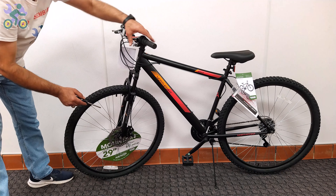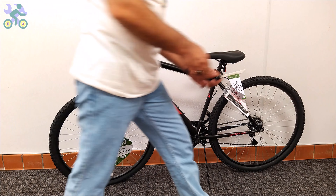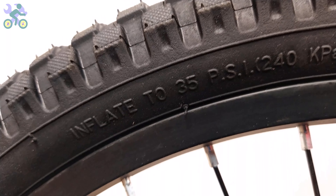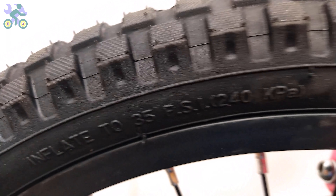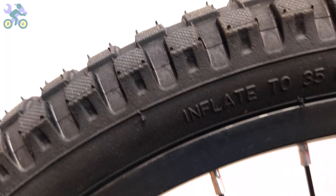At the end, it's necessary to check the work done and make sure all bolts and nuts are properly tightened. When inflating tires, some people inflate to the amount indicated on the tire, but that value represents the maximum air pressure the tire can withstand. For most bikes, the recommended air pressure is between 25 to 35 PSI. After inflating to 20 PSI, sit on the bike to check the tire pressure; if the tire is not fully inflated, increase the air. Remember, the weight of the cyclist determines the amount of tire inflation.